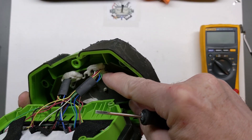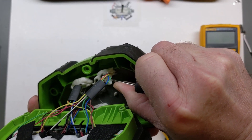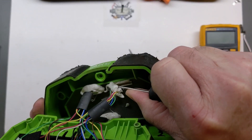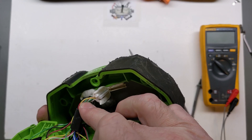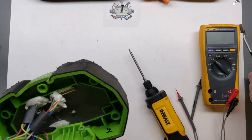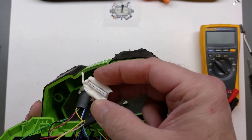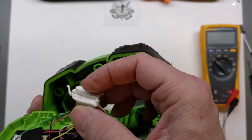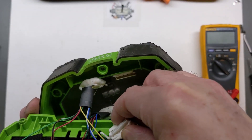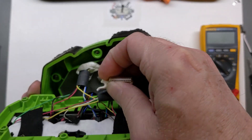You can see we're already at the connector. All we have to do is go around to all three and do the same thing, and the connectors will easily pop out without stressing or pulling on the wires. We don't ever want to pull on the wires themselves. Now we can just take our finger and roll this off fairly easily, even with one hand — not difficult at all.